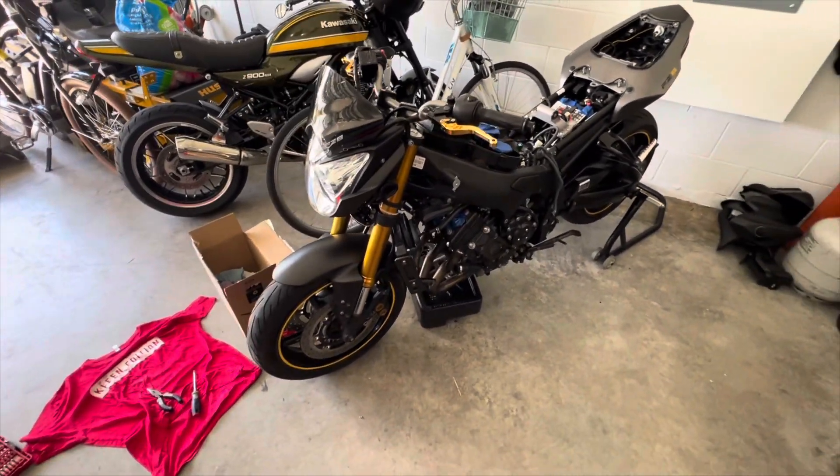Don't be concerned — when I was taking mine out, this little board, the actual sender unit, popped off. It's fine. I think it's meant to, because it pops right back into place when you have it out. There are two wires you disconnect from this main base right here. Where did my fuel filter go? Oh, here it is. So this is the fuel filter. This thing was a pain to find because I could not find any straightforward information online about where it was or if you could even replace it. I couldn't find one in-line. So I was like, okay, it has to be in the fuel sender unit itself.